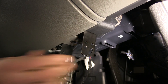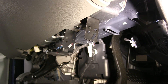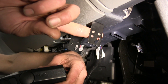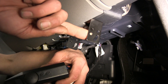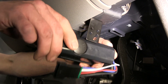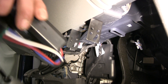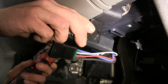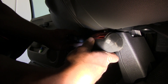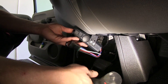Our bracket is mounted nice and solid. Now let's get our brake controller into position — this also uses self-tapping screws. We have an option: to mount it flat, use the two holes on the side with the top holes of the bracket. For adjustability, the lower set of holes has a fixed hole on the front and an elongated rear hole for up and down movement. I'm going to use the bottom set. The hardware you need is provided — don't use any hardware that's longer or you might damage the electronics. We'll position it running up nicely against the bottom of the dash.